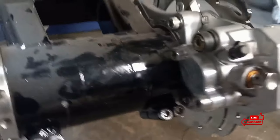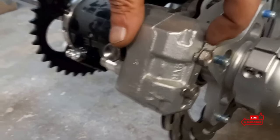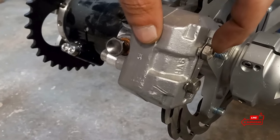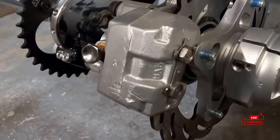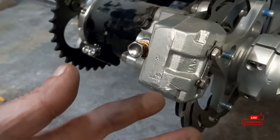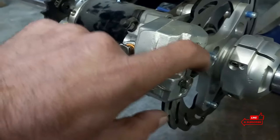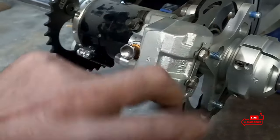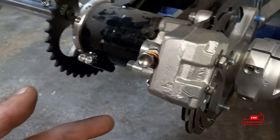To change your brake pads, these two bolts are 10 millimeter, and you see this little plate behind them — when you tighten it, you bend down one of these tabs so these bolts cannot back out. You definitely want to put this back on. Other style brake calipers, like on my 250R, these pins are hidden inside the caliper with a little cap that blocks them off to keep the threads clean. On a 400EX they're just exposed, but it's the same basic principle.